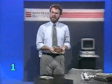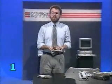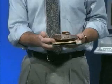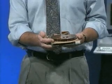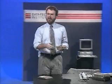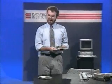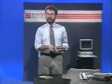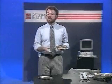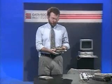How does a disk store data? Notice first that there's more than one platter. Two, in fact. We use both sides of each platter, so there's 4 surfaces to store data on. The data is stored magnetically, as is done with a video cassette. Some hard disks use as little as 2 surfaces, some use as many as 16.